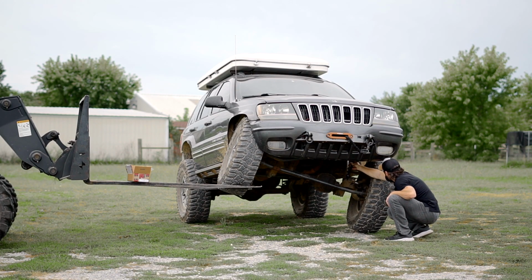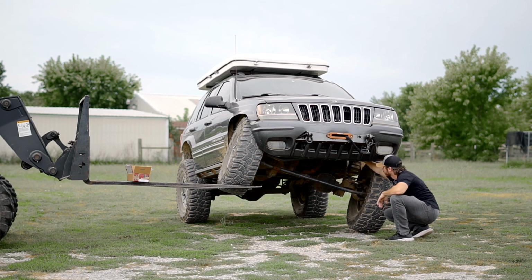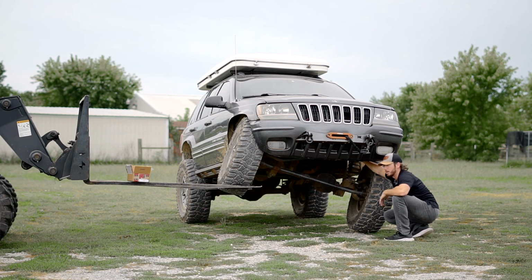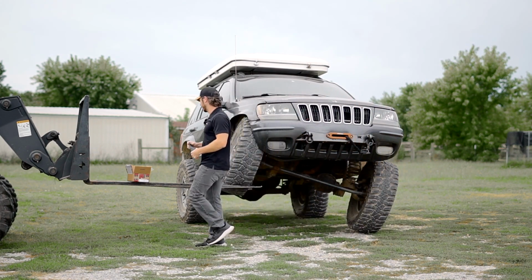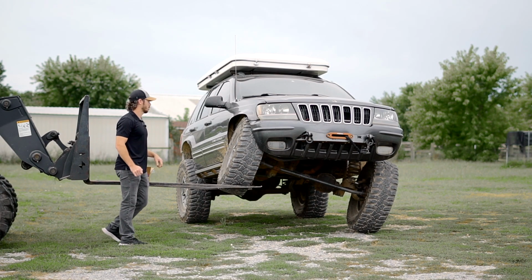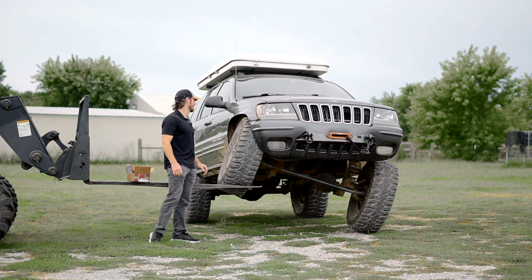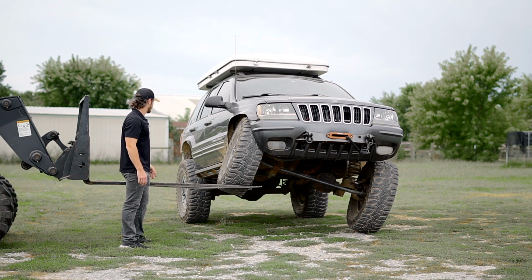So our first bolt hole is really like there, and the spring is just barely starting to come out, so we're gonna need like 18 to 20 inch limit strap probably. So I wanted to get that on here and measure and kind of see. We're not touching anything right here with the tire straight. If you turn it, obviously it's gonna start rubbing more stuff. It does tuck pretty well though.